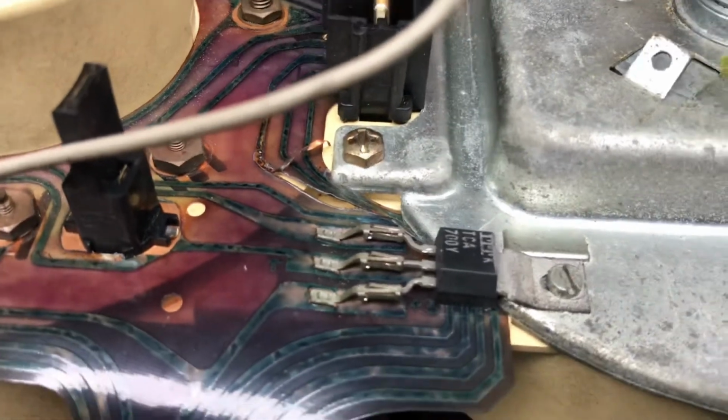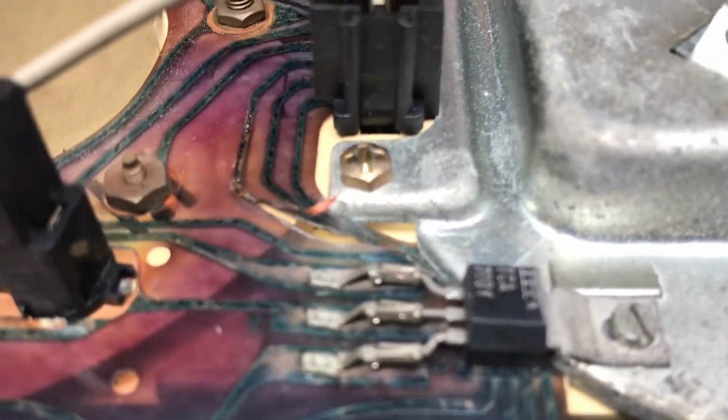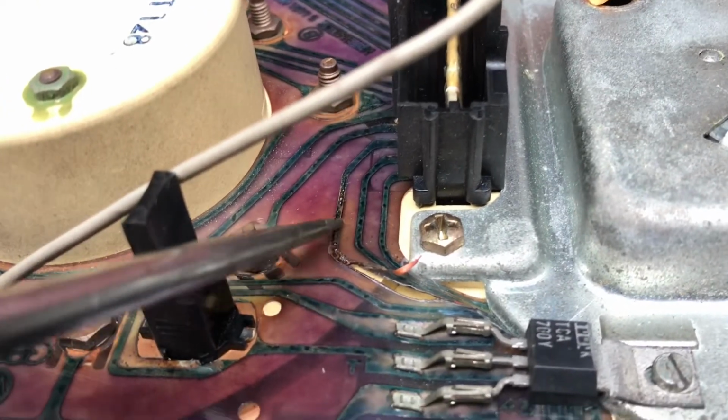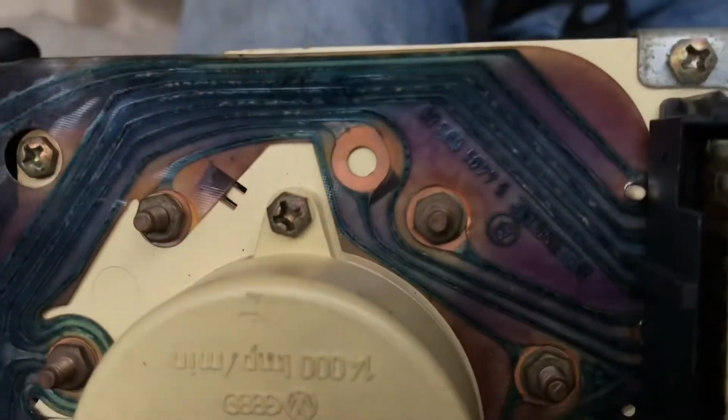But there's another obvious thing right there you guys can see. Focus. This wire is broken right here. It is just a lighting circuit. I put the parking lights on and that's what it does. But as you can see, these others are not in much better shape. Our gas and temp gauge are down the bottom here. I'm guessing those two terminals. Yeah, those two probably.